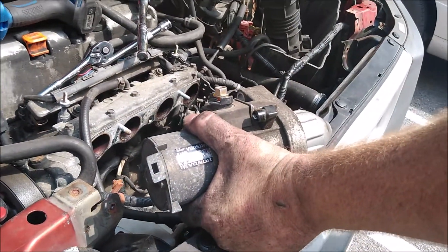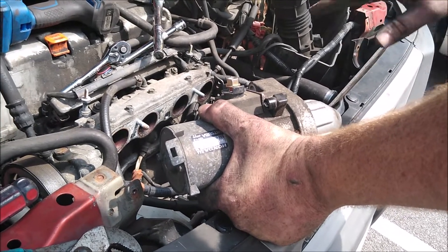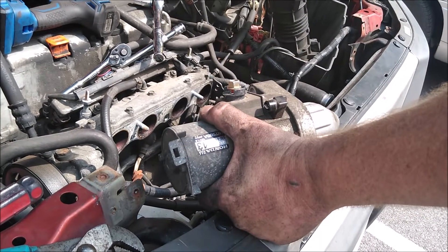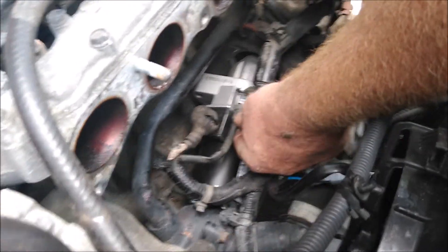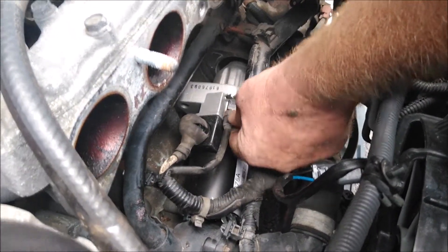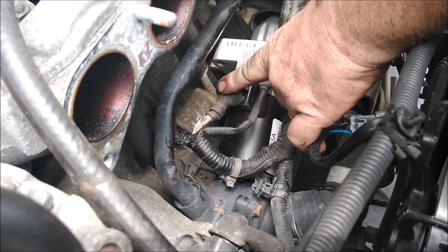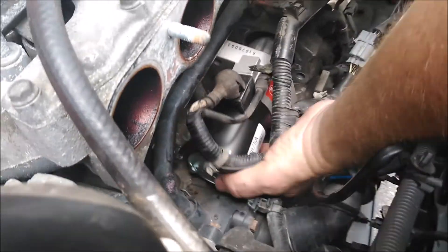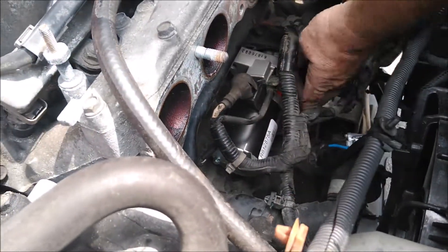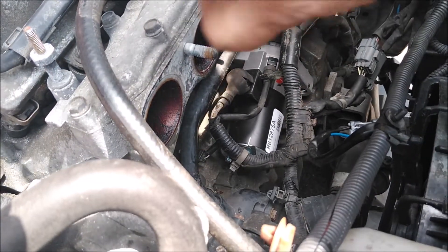Since it's a mobile call, I don't have the starter yet, so I'm going to go get it, come back, and then we'll put it back in and hope that she cranks. Just set your new starter in there, hook up your solenoid wire — just push it in — then tighten down your battery cable with a 12mm, tighten it until it's pretty tight, and then put it back in the hole and start your bolts. Line it up, start the bolts, and tighten it back up.